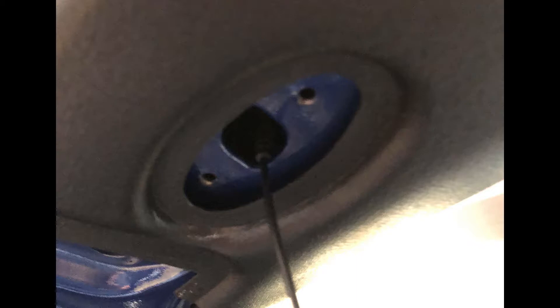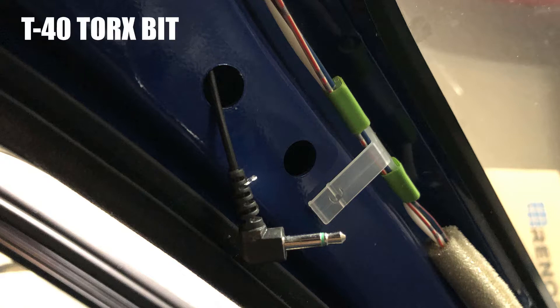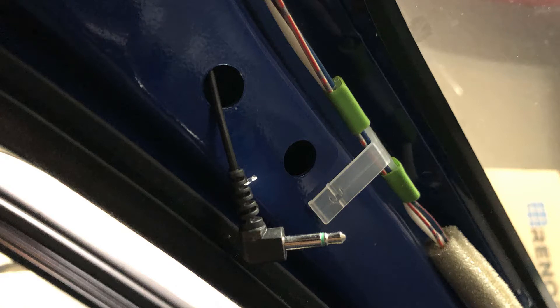Here I have started to fish the wire through. For removing these visors it's very easy — there are just two screws and then they come right off, and the blank just uses the same screws again. Here you can see the wire coming out of the hollow A-pillar after removing the driver side trim. To remove that trim you use a T40 Torx bit on the convertible latch bracket, and with those two large screws out the trim comes off pretty easily with trim removal tools.